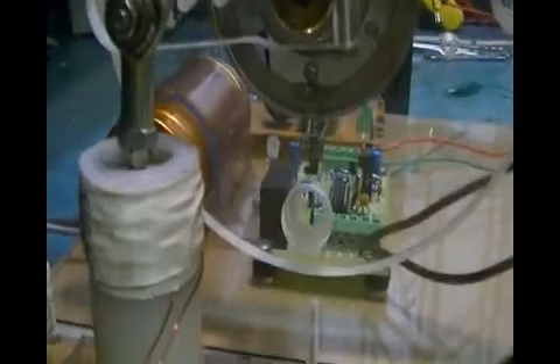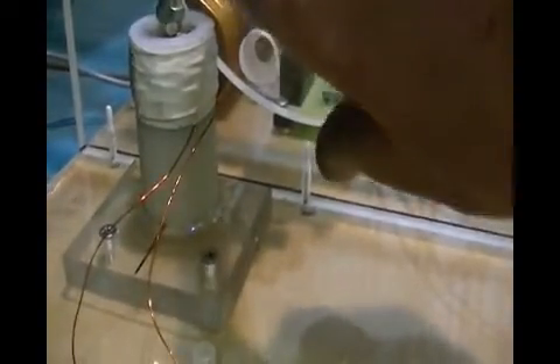We can change the effective size of the motor just by shifting one bolt into either hole, and moving the cylinder over so it's vertical with the system. If we want to put it in a small car, we use a shorter stroke, less power, or a smaller cylinder. For more power or torque, we go to the outside hole and we have a truck engine. That's how she works.